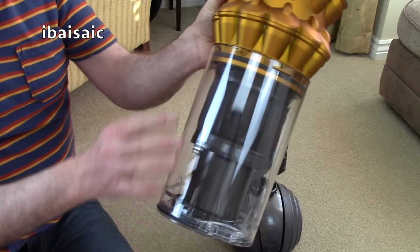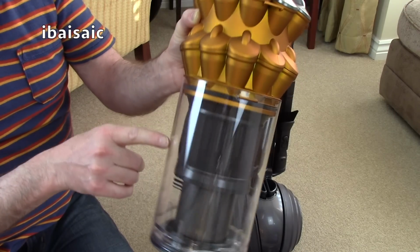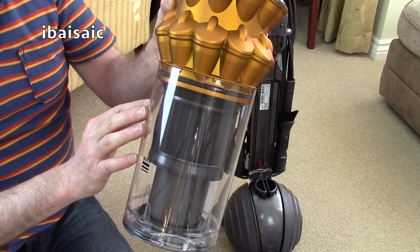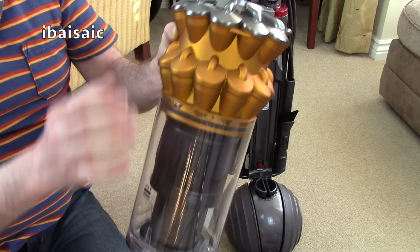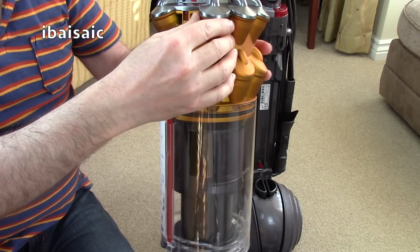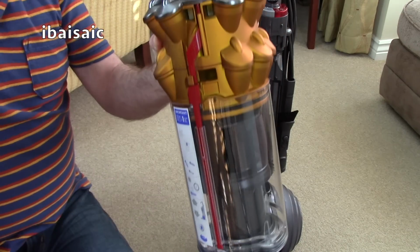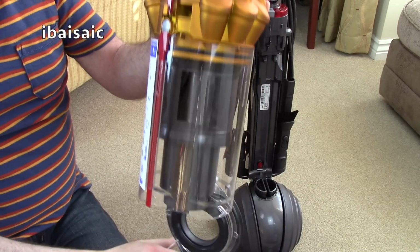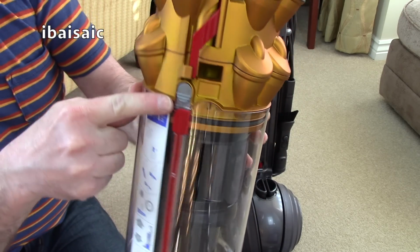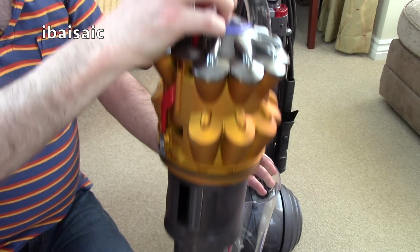Now, from time to time, you might want to give the cyclone and this mesh screen in particular a bit more of a clean, especially if you've got pets or long-haired people. Threads and fibres and pet hair, etc., can occasionally wrap around the central screen. So to give that a more thorough clean, you first need to empty the machine if it's full. But if it's not, you also need to press down on the button to open up the little flap. And when you press down on the button, you can see you've got access now to a silver button there. So you press that in,